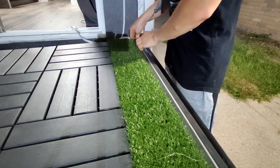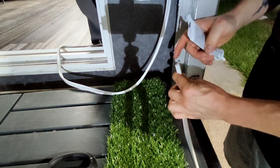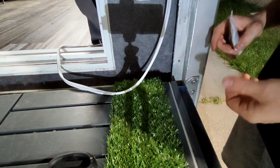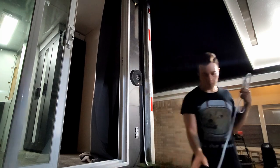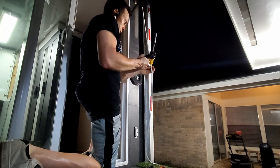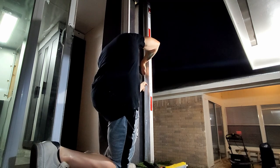This stuff's really easy to cut to length as well — we're just going to snip that and add a little silicone to the end to waterproof it. I ran the same LED wires up the sides of both ends of the truck, and we're going to add some silicone to the entire rope and fasten that back in the nook on either side of the truck.